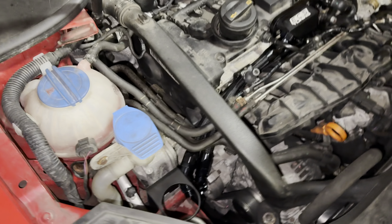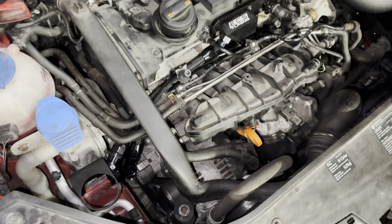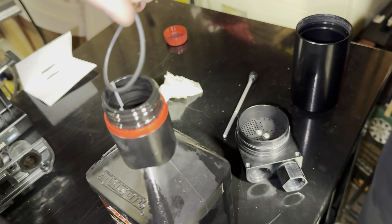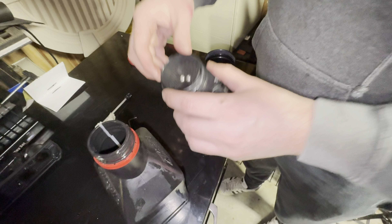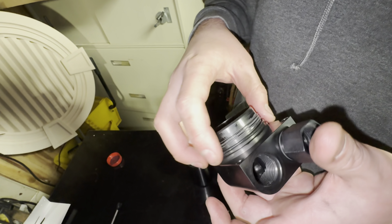So the next step is getting this return line fitted in. We're going to lead this one in backwards or forwards — we can do whichever. We'll put a little brake cleaner on that. It's going to be going the exact same way the feed line is — underneath the fuel lines, underneath the engine mount, and right up to this corner. We're going to thread it in like that. Just give it a little snug, and that's it. You do not want to strip these because then you're going to have to buy yourself a new one.